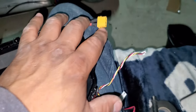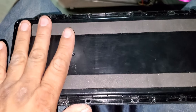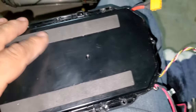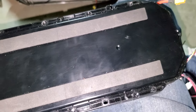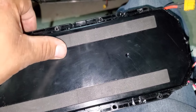What's up guys. I found out what was happening with my scooter — the Ninebot Max G30. I was having this issue where it was turning off. I found out it was not the controller nor the dashboard. What was happening was that my scooter would turn on, I'd ride it, and 10 seconds later it would shut off, then turn back on, but it wouldn't last long before shutting off again. The battery BMS was actually shutting off my scooter.